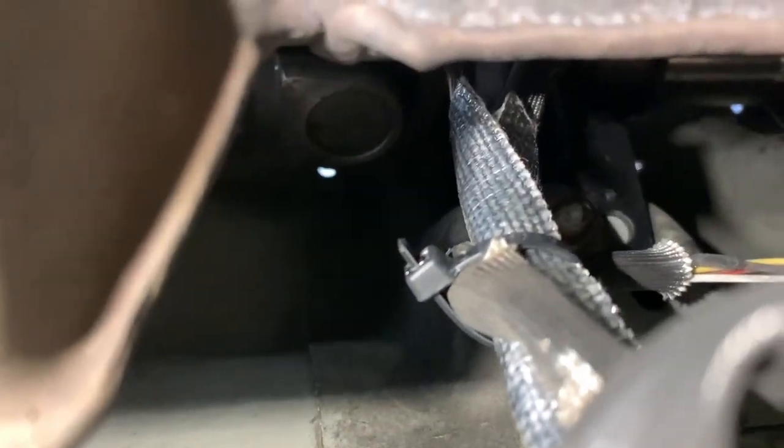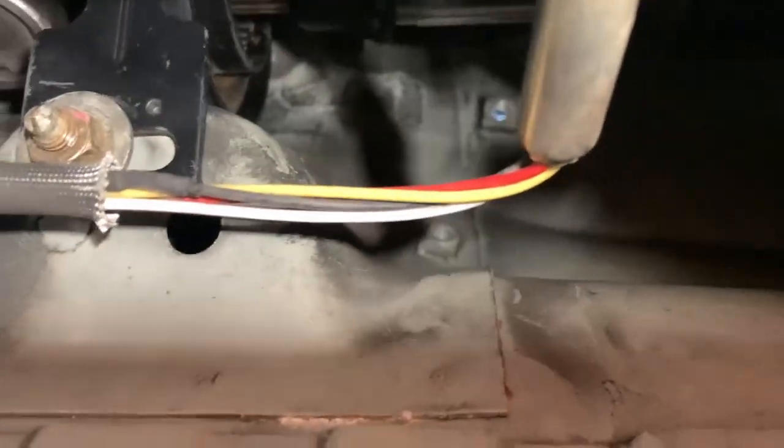We're under the car and this is why you want to check stuff before you start designing. Those holes are where the console mounts, and then the other hole is up there for the back of the center console. That's where I ripped out the cables to the stock handbrake — it's in a sealed box holding the center support bearing. That means I cannot put a plate here to sandwich because there's nowhere to put a plate unless I take out the entire bracing and the driveshaft — that's not happening. I'll probably have to weld those holes shut or use panel bond, but I'm worried about sparks going in.